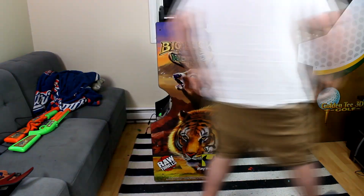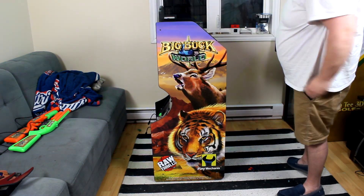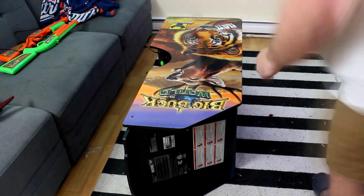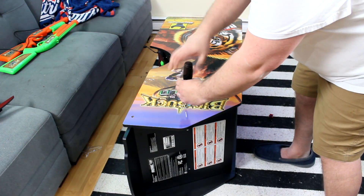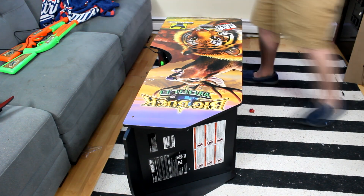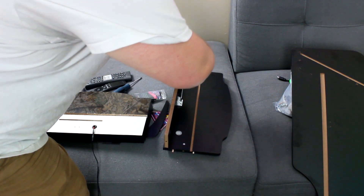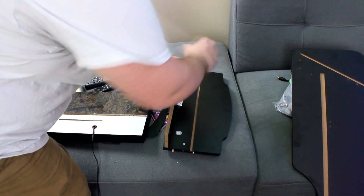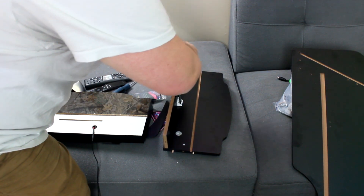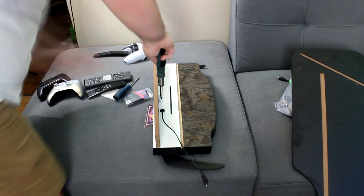When it comes to the mod, this one is relatively easy — believe me, if I can do it, literally anybody can do it. The first step is getting the old wooden marquee out. There are two ways to do this: you can loosen some of the screws on the side and wedge it out, or take apart the entire cabinet to get the marquee out safely. Once the wooden marquee has been removed, you will need to separate the small bracket panel on the bottom of the marquee — which connects to the sides of the cabinet just above the screen — from the back of your wooden marquee, and screw it into your new light-up marquee from Retro 530.